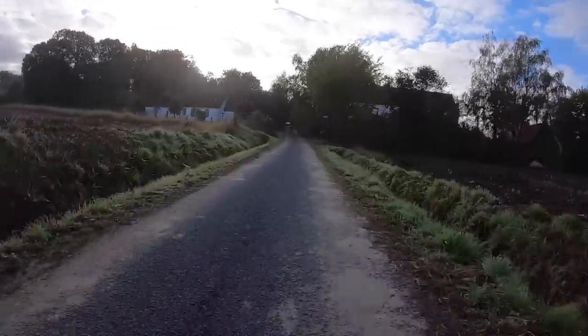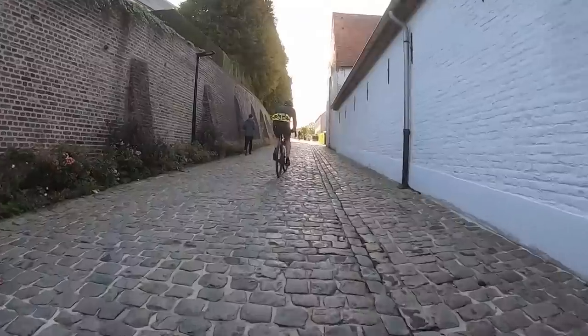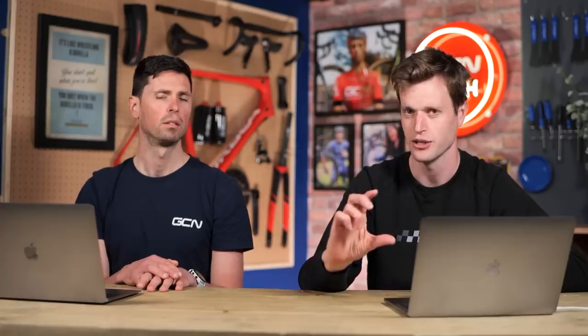That's perfectly normal. I'd go as low as you can go without the rims hitting the stones or tree trunks or anything like that. I'd just go as low as I can because it's way more comfortable — you have more grip and it feels faster when you're on the rough stuff. The tire looking a bit squishy is actually quite a good thing when you're riding off-road, because it means it's able to deform over all of the little bumps and stones and rocks. Whereas if you pump up harder, it's just going to make the whole bike bounce around. If there's no sag at all, you're just going to feel all those vibrations — it's going to be like riding on rocks.